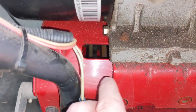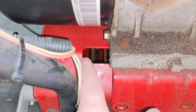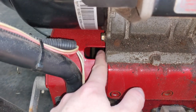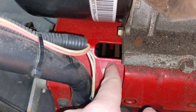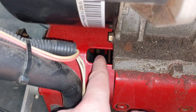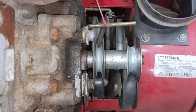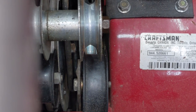On the other cover they had that overhang that comes way back here. On this particular 1450 chassis, they have this large rectangular hole. I can already see the issue — if I use the 1350 with the 1350 plate, that's going to be exposed. Now I could tape over that to cover it up, but the 1450 plate has that overhang that would come over this. I'm assuming they have that there to prevent snow and water from going into this area — water getting in there could cover your rubber friction disc and cause drive slippage issues. However, having a little overhead view here, you guys can see the pulleys are almost perfectly lined up.